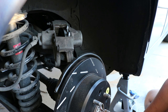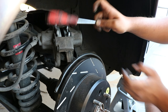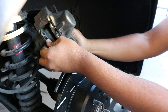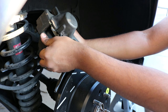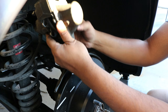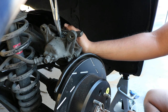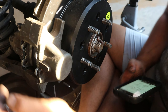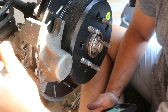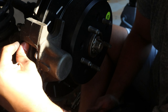Now for the other one — let's do the same. My question is how worried should I be about this? My worst case scenario is the brake fails on this one particular caliper, and I realize it and fix it, because I'll be coming back to check on these in a couple weeks. You can definitely see that there is an issue right here where they don't line up flat. What I ended up doing is actually taking these pads in and out repeatedly, to the point where they go in and out a little bit smoother now. They're still kind of difficult but they seem to be moving back and forth at least.